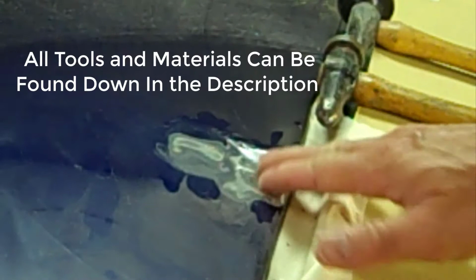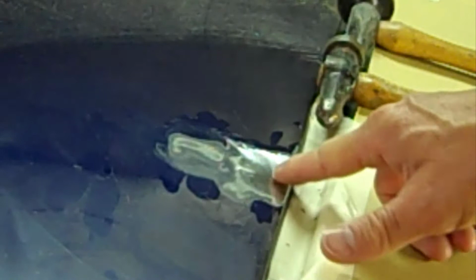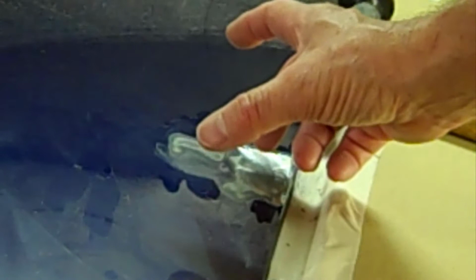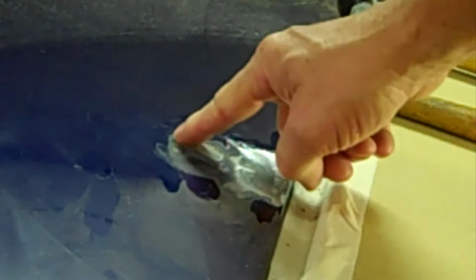Okay. This is mostly pulled up. It's still got just a hair of a bit of a dip. Real mild and faint. And since this was creased in right here, it'll have to have a little bit of fiberglass put in it. But this is a high. Of course, when it was shining, I could see that. The only thing I don't like about that kind of hot glue type puller is sometimes it'll put little outward pooches in it. And you can use a Teflon stick and tap them back in. Of course, this one's kind of high.